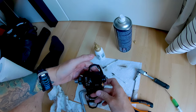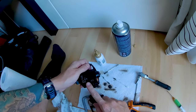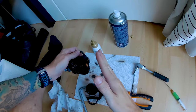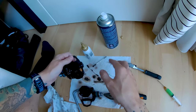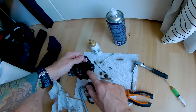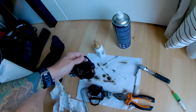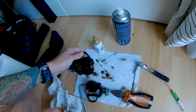For the batteries, I can recommend lithium batteries found on Amazon — they come with around 1.9 volts charge and you can easily get 60 hours out of them. It's not worth trying normal batteries because the voltage drop on a normal battery is linear: they start full at 1.5V, then as they get lower they drop to 1.2V, and as soon as they hit around 1.3V this device cannot get enough voltage to run all the electronics. If you have a lithium battery with 1.8–1.9V, they will stay quite stable at 1.8V and then when they are empty they drop instantly. So you get a lot more hours out of them compared to NiMH and alkaline batteries.